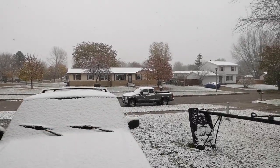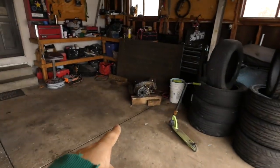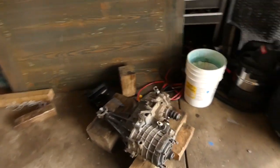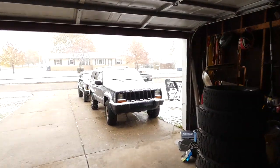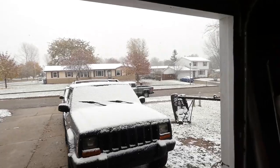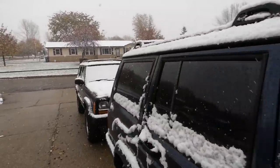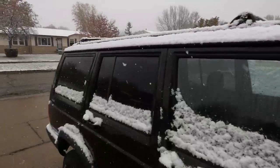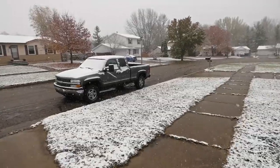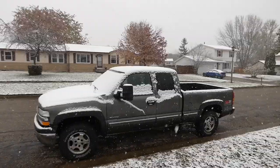But before that, we're going to go work on this truck. I already bought my transfer case, which is right here on the floor. But before I just blindly go ahead and put that in and take that guy's word for it - maybe he didn't know much about cars - maybe we should try to drive this and get it in four wheel drive and see what it does. It could be that front actuator. Look at this weather, it's already here.